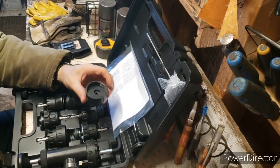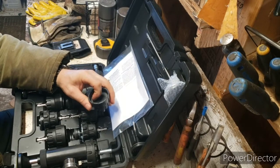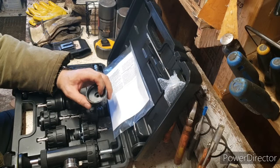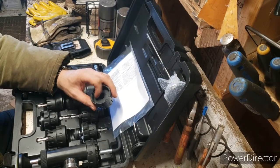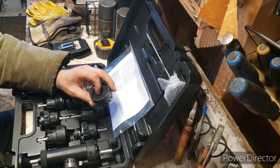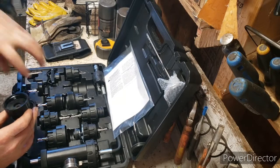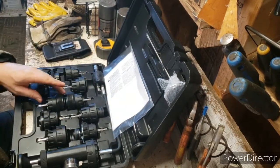This adapter fits on the threaded portion. On the 2007 Ford Focus, like many vehicles, there is no rad cap — the cap is actually on your overflow tank. This one fits on there no problem, but the only issue is it doesn't seal right because it has to go further down.